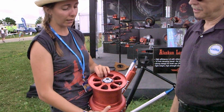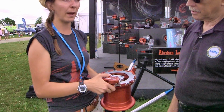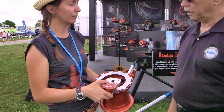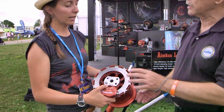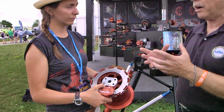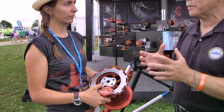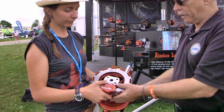It's a really light wheel, completely adapted for 2,000 pounds gross weight aircraft. Oh, wow, really? Yeah. And this has your floating disc brake in it, which is such an innovative idea that keeps both wear down and that chattery noise that sometimes happens with a disc brake. Doesn't happen on this. May I see how heavy it is?